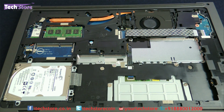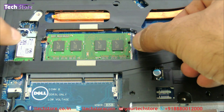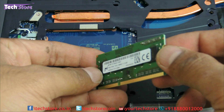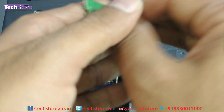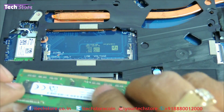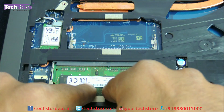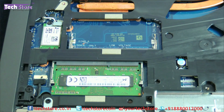As you can see, there are these two notches over here. Just use your two fingers and the memory will come out. It is basically a 1600 MHz DDR3L memory — low voltage memory — that you have to buy. You can buy a 4 GB or 8 GB stick from Corsair, Zion, Transcend, Kingston, or any compatible make. Just take the new memory strip, insert it in the slot like this, and press it down — the two notches will take over and hold on to the memory.